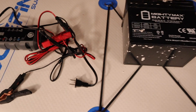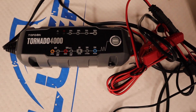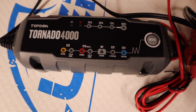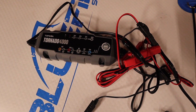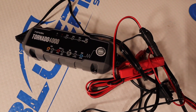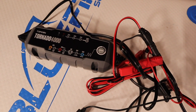To charge the battery, I've got a Tornado 4000 charger. The reason we went with this charger is a couple of things. It has the ability to do regular lead-acid, AGM batteries, and lithium batteries, so if we ever move up to a different battery this thing is a little bit more future-proof. And it has the ability to charge a battery from a very low charge, which some of them don't. So if we overdraw this battery, we should still be able to charge it back up.